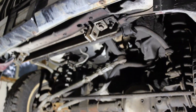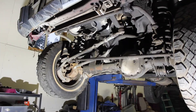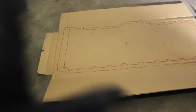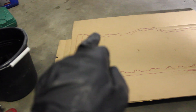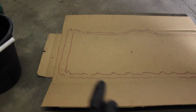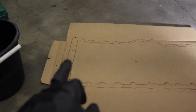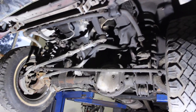Jeep is up in the air like usual. I'm about to remove the oil pan. I took the box from the new gasket, traced it out, drew all the holes. I poke holes with the screwdriver at the points where the bolts go. Then I just remove each bolt and stick them right in their place so you don't mix anything up. The skinny end goes on the back, the fat end of the oil pan goes on the front. I drained all the oil first.